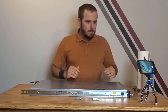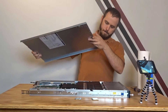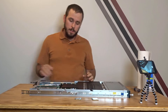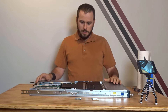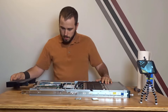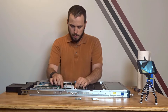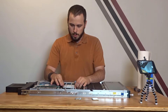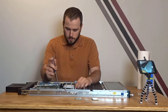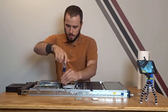Okay, so we're going to go ahead and take the top off this guy. The CPUs are going to be under the heat sinks. Very simply, the vast majority of these — at least on Nehalem-based systems — are going to be held down by two screws. You may see four screws on the corners on some newer sockets, but primarily you're going to see two screws holding it down. Let's take one of these guys off and take a closer look so you get an idea of how it works.